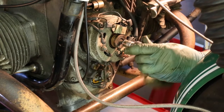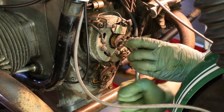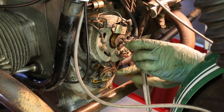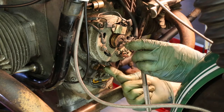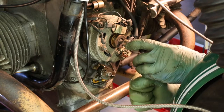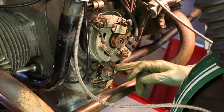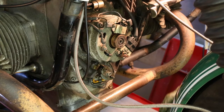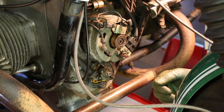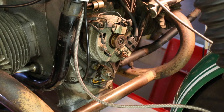This is a twin, so we've got a twin-lobe cam in here. When the advanced retard unit gets up to about that angle, the points will be fully open again — which they are just there. So I'm quite happy that I know the points are fully open. What I'll do now is adjust the points and then turn the engine over a couple of times, bring this up so the points are fully open, and check the gap again.